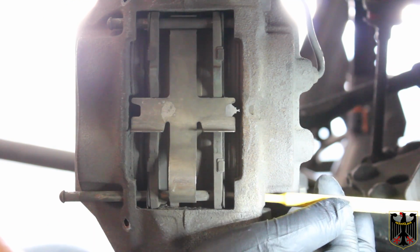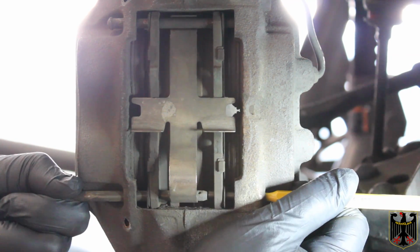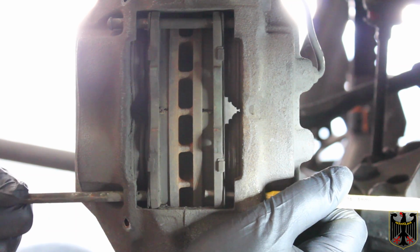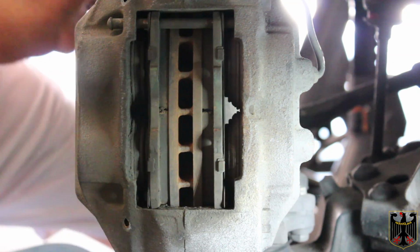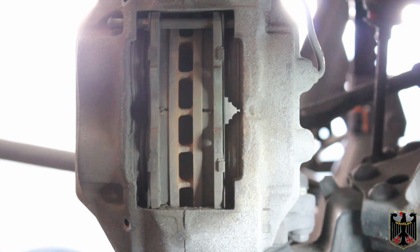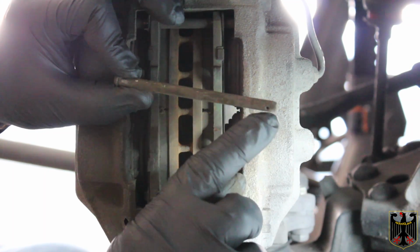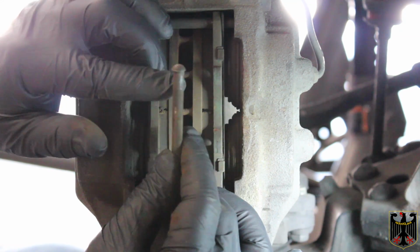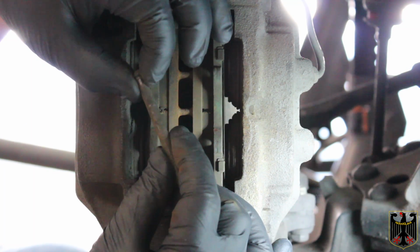Okay, I wanted to show you on this picture using a drift pin or drift punch to push this piece out. So I've got it to the point now where... That's why you wear safety glasses, by the way, because there went the anti-rattle spring that shot off. Looks like that. So the pin looks like this, and it goes in only one way. You can see there's a hole in it. That's for this side. And over on this side, some of them have a little capture piece here.